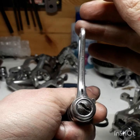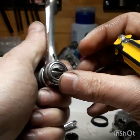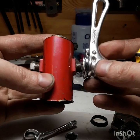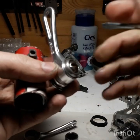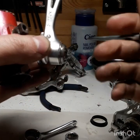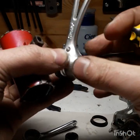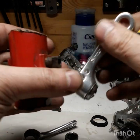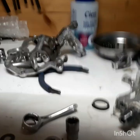The spring moves freely on its own, but when it's actually on a braze-on attached to a bike frame, the tension squeezing everything together makes the spring apply friction to the cylinder inside and not want to move. I'll put one together at the end to show you what I mean.